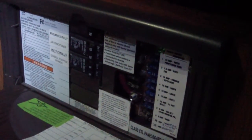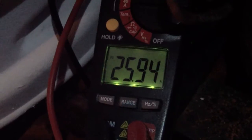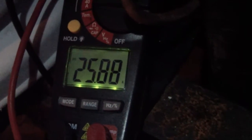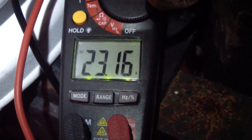I have to take back my remarks about the fan cranking up at high speed and roaring before — it turned out there was a wire brushing against the fan, so I fixed that. Now all you hear is a gentle hum; the fans are actually quite quiet. At 2 hours, the charge rate is 25.95 amps. It might be even higher if I upgrade the ground connection between the charger and the chassis ground. At 135 minutes, we're charging at 23.16 amps.